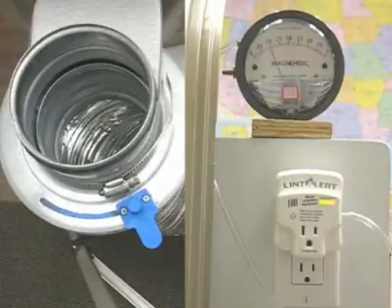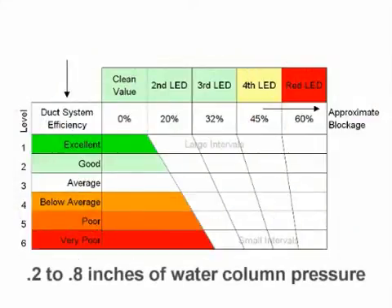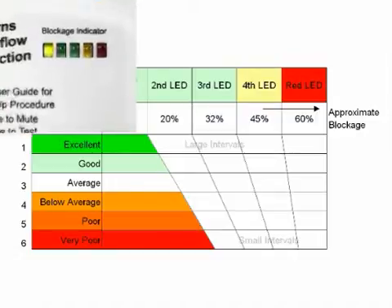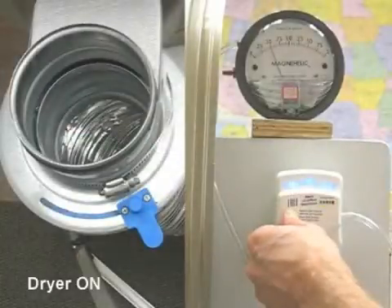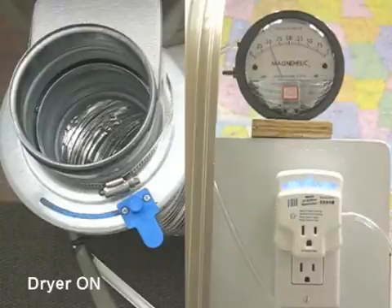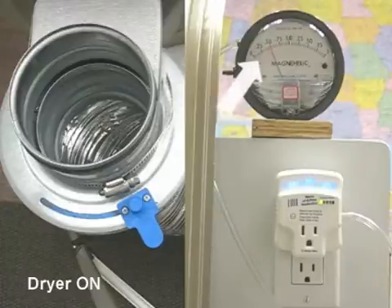In this final effort, we'll attempt a calibration with a typical or likely home environment. Pressure levels in this group range from 0.2 to 0.8 inches of water column pressure. Depending on what the LintAlert sensor finds, the microprocessor will determine what pressure intervals to use to illuminate the LED blockage indicator lights. The lower the initial clean value pressure found, the larger the intervals; and the higher the initial clean value pressure found, the smaller the intervals. In this example, we successfully captured a clean value pressure of 0.5 water column inch, a pretty good mid-range or typical level. After a slight pause, we observe the first green LED is illuminated, indicating that the dryer is on and that about the same amount of back pressure exists as when we initially calibrated.